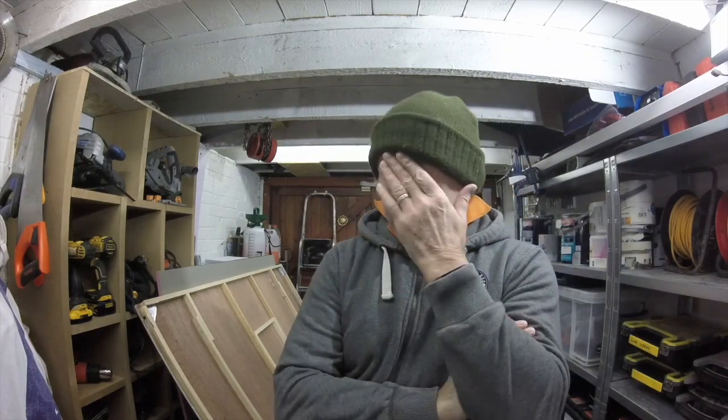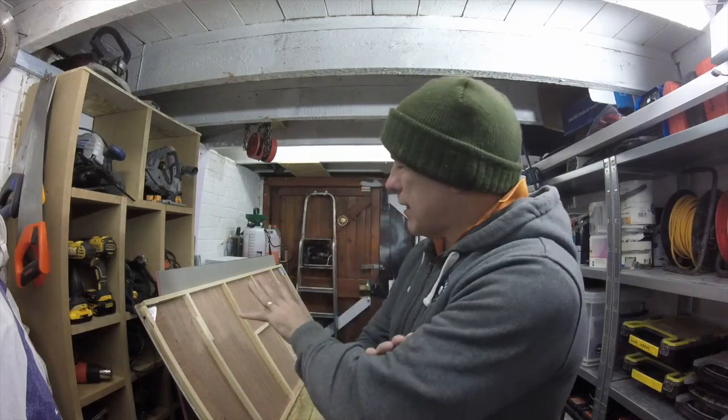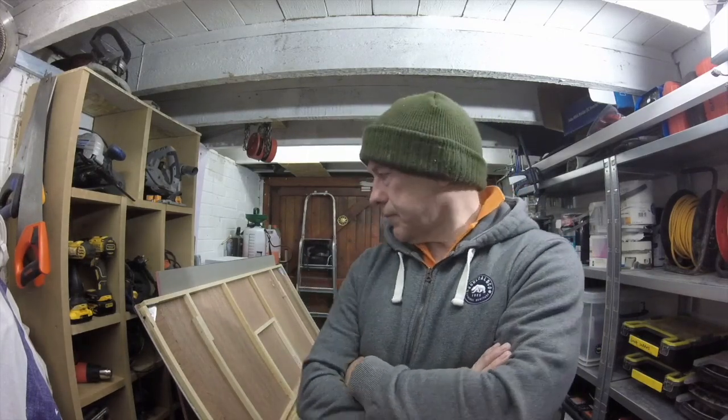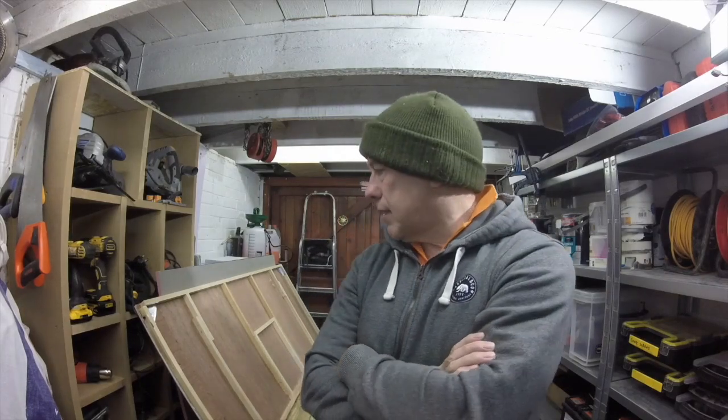So when I made this hard top, the idea was that I didn't need rigidity, I needed something pretty solid, but something very light. It's going to be like a canopy above my head as we're going, and you've got the wind, you've got the direction, it acts like a sail on the boat as well. So it's got to be strong. You've also got to be able to grab hold of it and hang on, so to speak, should you need to. So the idea was using a marine ply.